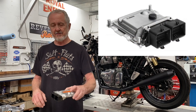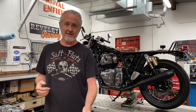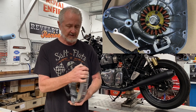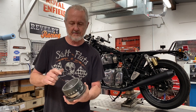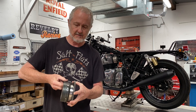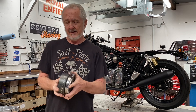Next is the ECU — Electronic Control Unit — and that's exactly what it sounds like: it is electronically controlling this whole system. Like any other process, it has inputs, processing, and outputs. The inputs to the ECU start with crank position. It picks up crankshaft position from a sensor inside your left-hand side cover — a little magnetic switch that produces an AC pulse based on small nubs attached to the rotor on the end of the crankshaft passing it. Every time one passes, it sends a pulse to the ECU, which uses the gap to determine crankshaft position and speed, so it knows how fast it's turning and where the piston is in its travel.